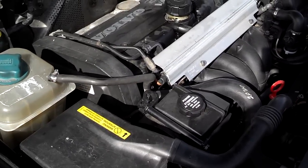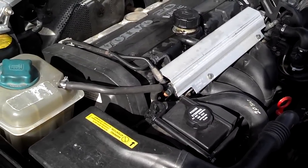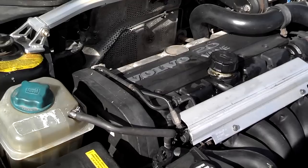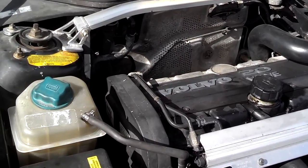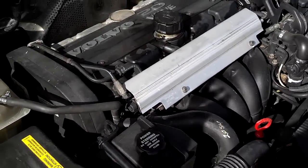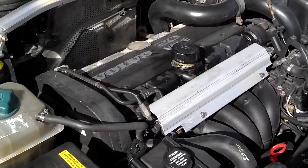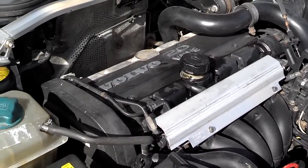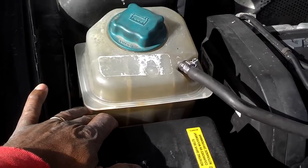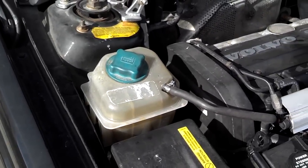The next thing I want you to do is check your coolant system for old and deteriorated hoses. Replace any coolant hoses that need to be replaced, because you do not want to play coolant roulette with these cars. A leaking hose can turn into a burst hose, which will cause you to lose coolant rapidly and overheat the motor. Check to see if your hoses are soft and pliable. If you have a turbocharged car, find out how many hoses you have and replace the ones that are old. Check your coolant level in your coolant bottle — if it's damaged or cracked, replace it so you can monitor it. Check it every couple of weeks, make sure the level's not changing, and make sure you have coolant in the car — not straight water.